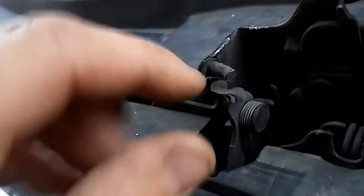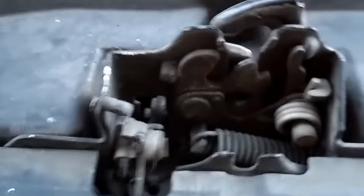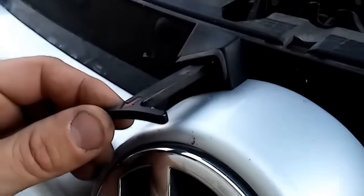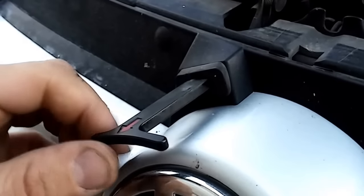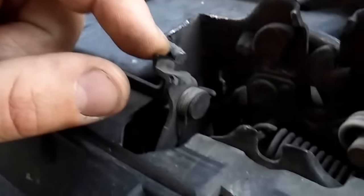The critical area I found is right here where this little guy touches right there at that critical point. What I've done here is I've bent this pin toward the front of the car and down a little bit. That makes it so that when this guy is in its natural out position — not the fully pulled out, but the natural out position once you crack the hood — this guy should damn near be touching up here. Touching or damn near touching, so that when you go to close the hood, it'll engage this other point that also has to do with it.